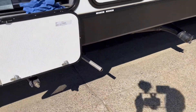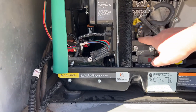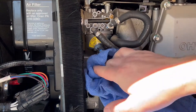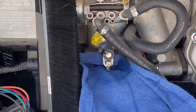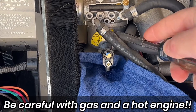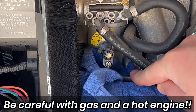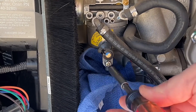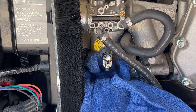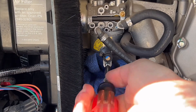Go ahead and shut it off. You see a little bit of smoke — that smoke is basically inside the cylinder coating it, so that part is done. Now we need to drain the carburetor of all the fuel. This will only take another minute or two. Go ahead and get a rag and place it underneath, then open up the float bowl drain screw — this will drain the fuel onto your rag. Make sure you have plenty of rag in there because it only drains for about 10 to 15 seconds. Once it's fully drained, go ahead and close that back up and tighten it down.